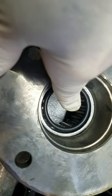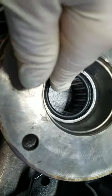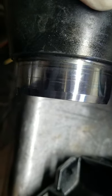That o-ring is supposed to stop the fluid from coming up through the shaft and spline area of the coupling, but it gets hard and stiff over time and the fluid just passes right by it. You look at the seal surface area of the coupling — it's beautiful. Low hours, it's a freshwater boat, so that helps a lot. But those are the two areas to look at.